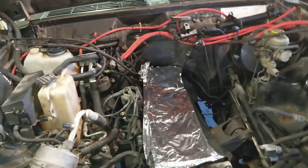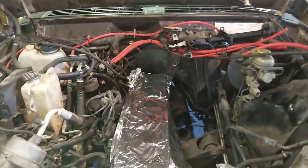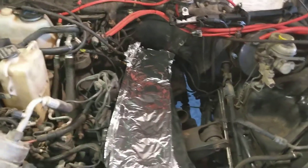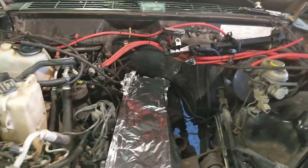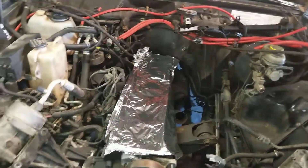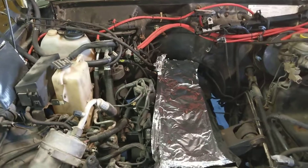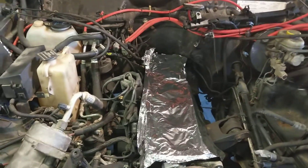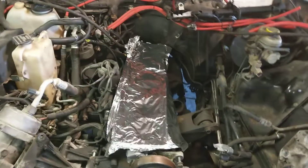This had the infamous six-cylinder spark plug that had never been replaced because of the firewall interference thing — it was very, very old. The other ones were replaced at some point. New spark plugs and a tune-up pretty much fixed the misfire and the little bit of weirdness it had.